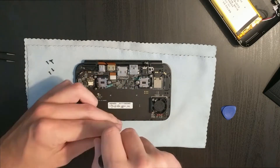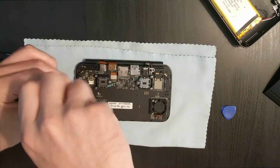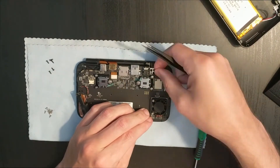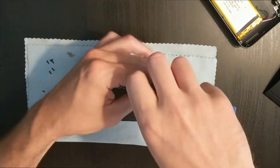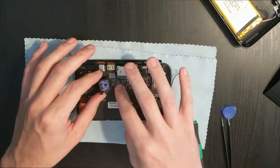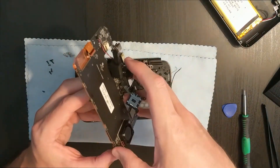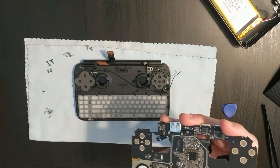We need to get to the back of the main board, so we're going to be removing screws. There is a screw behind one of the cables that attaches to the Wi-Fi card, so make sure you remove both of those cables. I did not remove the speaker or the two analog stick ribbon cables — I find they're a pain to disconnect and reconnect, so leaving them connected hasn't caused a problem. Now we can remove the heatsink and keyboard, just make sure you disconnect the ribbon cable first — I forgot to do that before and ripped the cable.